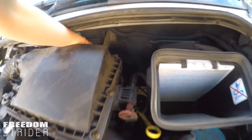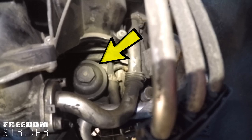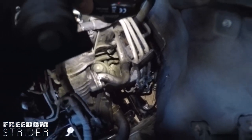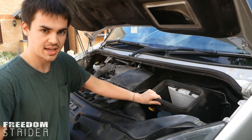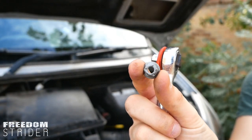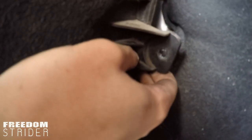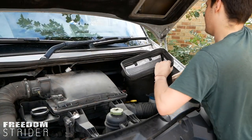Let me show you closer — let's take you through the engine. See that thing with the big hexagonal bolt on top? That is the oil filter. From a zoomed-out perspective, it is buried right in the heart of the engine. There's no chance we're ever going to reach it if we don't remove something, so we're going to remove the air intake first because it's quite easy to remove and it gives a lot of space. You need to keep the bolts — I think there are four — very safe.